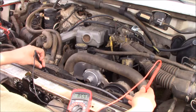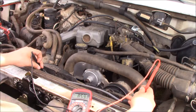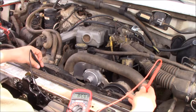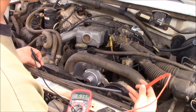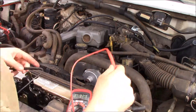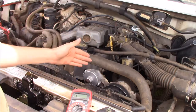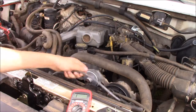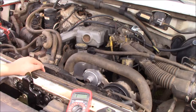As you can see, I have like 8.59, 8.62 — hope you can see that. That means that they do work. So that means that this one is not a bad wire. Now you just want to go through your vehicle and do every single wire until you find the culprit or eliminate the option.